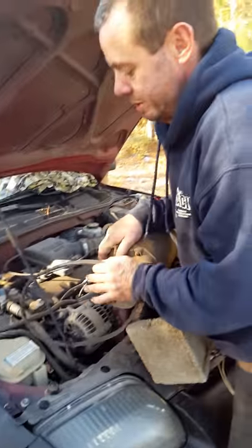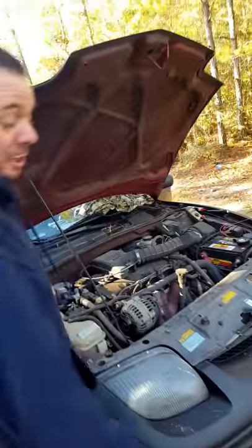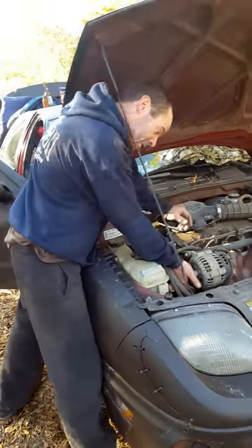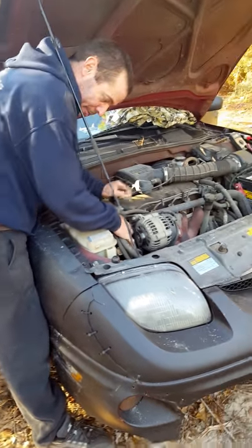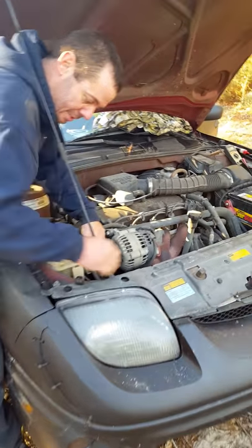After we've been stuck here about five to seven hours — the battery went dead because of another little scheme. I'm driving the car on propane. I had a toggle switch to turn the fuel pump off when I switch to propane. When I got here I forgot to turn the toggle switch off, so the fuel pump ran until the battery went dead. A grill bottle will get you there — this is how we live these days.